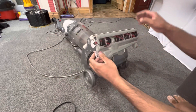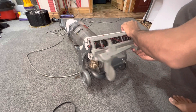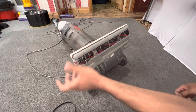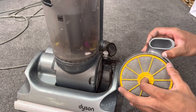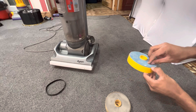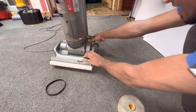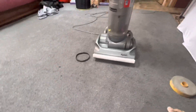Now make sure the sole plate is fitted correctly. I know this sole plate is damaged but it's still usable — I've seen plenty of worse examples of non-clutched DC07 and DC14 sole plates that are completely beyond use. So the sole plate's now fitted; it's a bit damaged but it will do for now and still has some life in it. Last but not least, the filter — I'm going to swap it for a better one because the old one is quite mank. You can wash these, but since I've got a spare one I'll just replace it. You can see the huge contrast: the old one is grey where it should be blue. New filter fitted and ready to go.